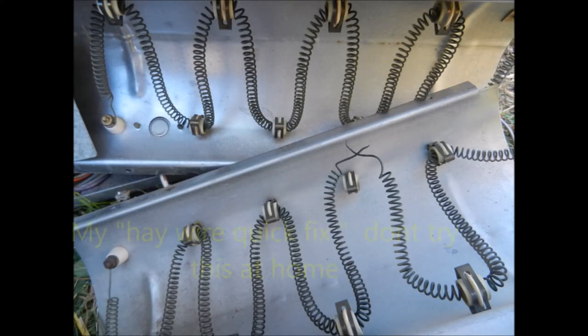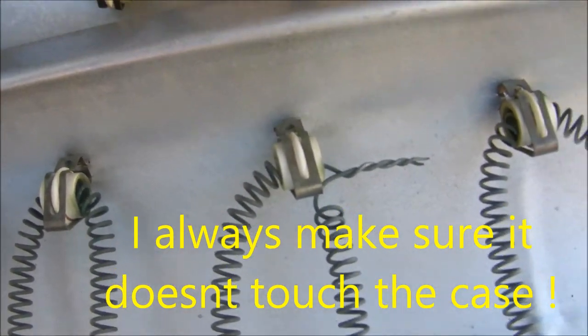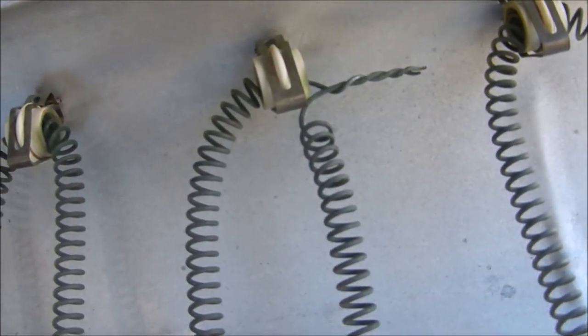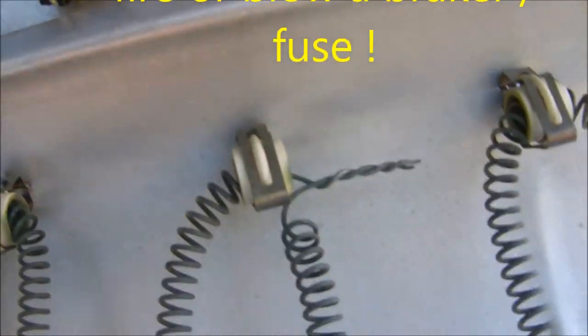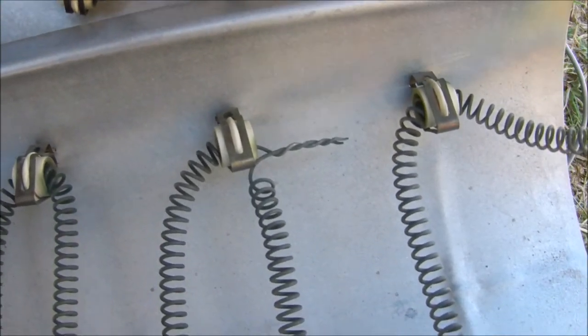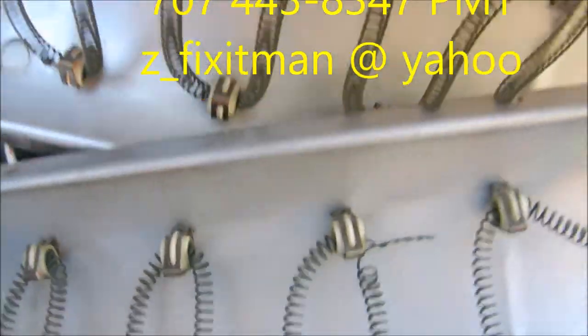What we're going to do is take that apart and tie it back together. It'll work for a little while — it's just a temporary fix. Then we can get a new heat element for it, but use it temporarily. The tie is right there. I clean it up with some sandpaper first before I tie it, and I try to make sure my hands are not greasy. I leave the end a little bit open — this is for cooling. So that will do it for this one. Thanks for watching. I give phone advice for $25 — you can call me at 707-443-8347 Pacific Time. Thanks for watching.